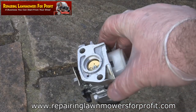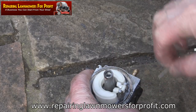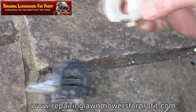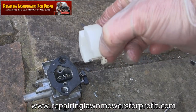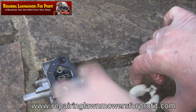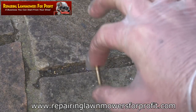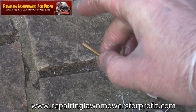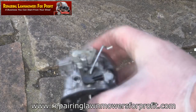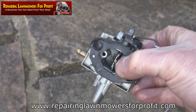We've got that off. I'm going to remove this pin and then lift this float away — there's actually a little needle in the bottom of there, the silver part at the bottom. You don't want to lose that. Now the main jet's just come out; you can see there are little holes in it, and if they get gunked up as this one has, it won't deliver fuel properly.